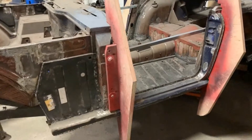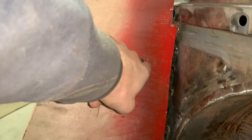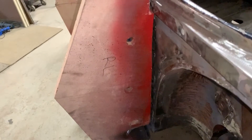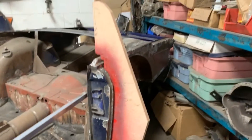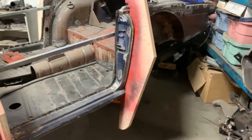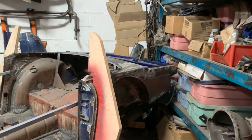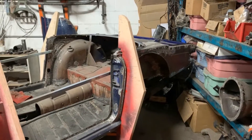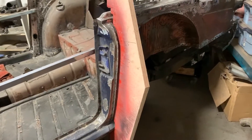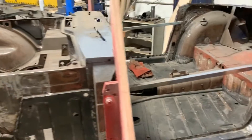The other side is mounted too. The front went perfectly, but for the back I needed to make one hole a little bit lower and the bottom hole a little bit higher — and that worked well. For some reason, not all B-posts are the same. If you're using my plans, I have measurements for where the holes go, but you better check your own car before drilling, or just make them oval like me so you can adjust, or drill holes through the entire B-post like Chef Tash did — though after that you'll have to plug those holes and make your own captive nuts for the fender fasteners.